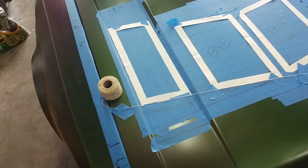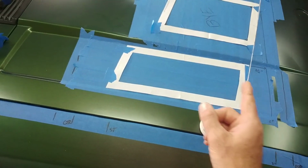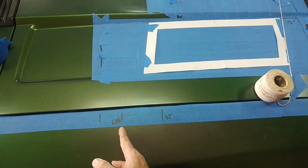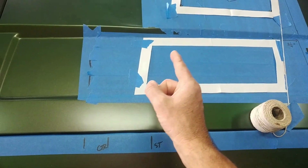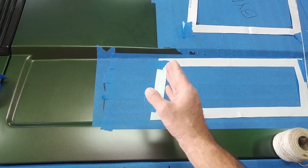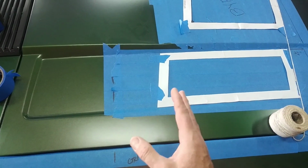And if you notice as I scroll around here, my target hot zone, or my sweet spot, was from here to here. So you can see it's centered in there. Now, I did raise the hood up to show you that the front of my strut tower is right here and the center of my strut tower is right here, just for reference. Note that when I cut out this center portion, all this metal is gone. The front of the strut tower is going to be right in this area over here. When I cut out this metal, I don't have to worry about anything hitting that strut tower. If this is placed too far back, you always have a mass air meter on these, an air filter, anything like that.